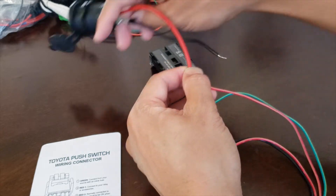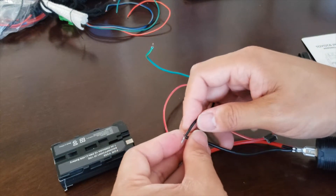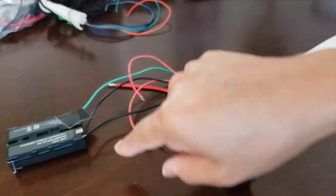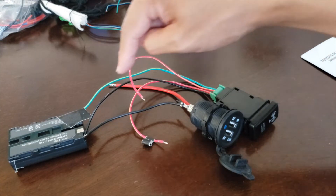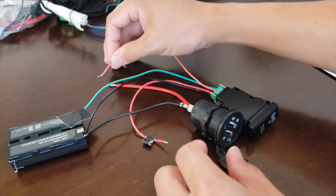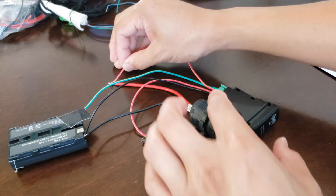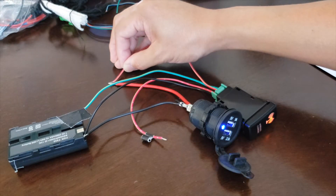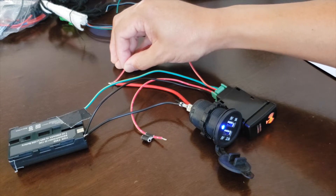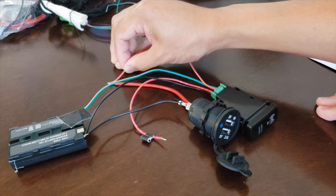For this example I'm going straight into the accessory. The black line — you solder the accessory's black line and connect these two together, and then they both go into the ground. So I have the power source going into the positive, the black line from the accessory spliced into the black line from the switch, and then the Red 1 wire connected to my accessory's red line. Everything is connected, so now I'll activate the switch by pressing it — and you see that the switch lights up, the accessory turns on. Push the switch again and it deactivates the accessory.